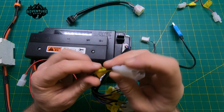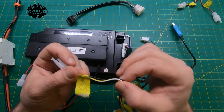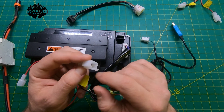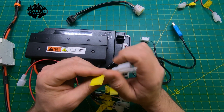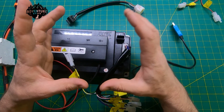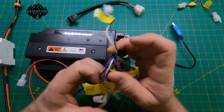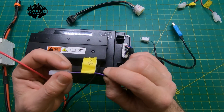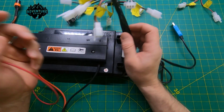This is the sport mode — there's a momentary boost or turbo feature you can put on a switch. It's the yellow wire with the white stripe; hook that to ground. All the grounds here are common. You can configure the boost behavior in the profile to run up against your maximum burst rating when you really need it. Also worth noting: the ignition wire wants battery pack voltage — 48 to 72 volts — not a separate low-voltage supply.